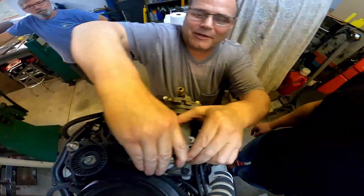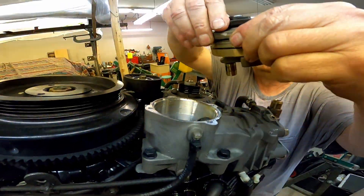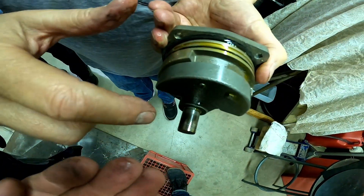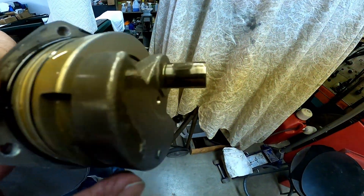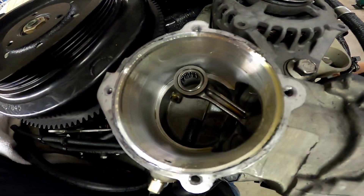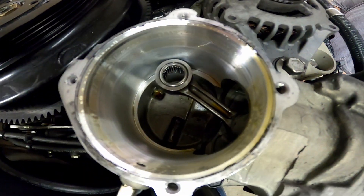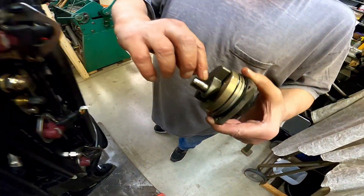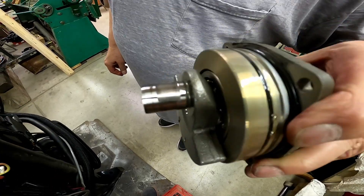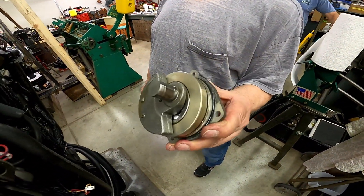You've got to be able to lift it up because it's got an O-ring in it. There you go — there's your problem right there. You can see it: see the wear on that side of that crank pin. There's what the crank pin should look like — and then you can see it from the side too. She's cooked. I'm pretty sure that bearing is not going to look great either. Well, actually it's not atrocious — the needles are all in it, I'm surprised. But you can definitely see that crank pin is junk — you can see the wear on the side of it. That's where all your slop and noise is coming from, and that metal is what's going to take your motor out.